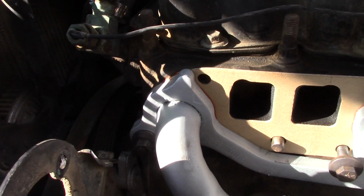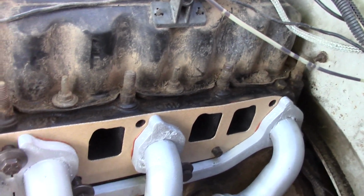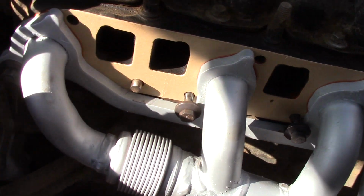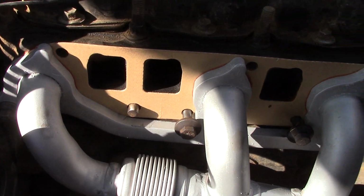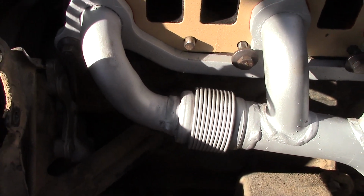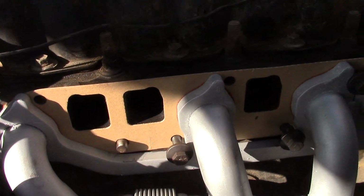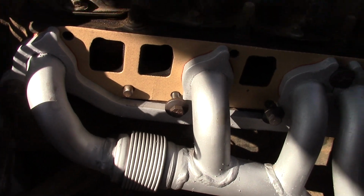Okay, so I did wire wheel all my bolts and washers as well. Not only does it make it look better, which isn't the main reason. The main reason is that with all of the threads clean, it goes into the holes nice and smooth, nice and easy. So those lower ones are in place, all of the washers are into the outside position. So once I clean up the intake manifold a little bit, I should be able to drop that right in place, get a couple bolts in the top, and then we're ready to actually tighten that all up.